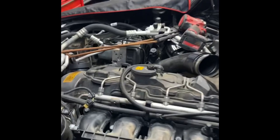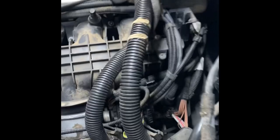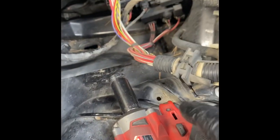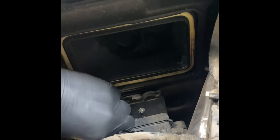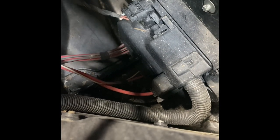I'm going to start to get the intake loose. A lot of stuff you can leave connected, but I'm going to go over here and disconnect this connection — it's like the power supply going to the DME. I do have the battery disconnected, which is one of the reasons I strongly recommend disconnecting the battery if you have to disconnect the DME connection. These connectors take a little bit of force — you need pretty much two hands to unlock and pull up on them, but still be gentle so you don't break those clips.